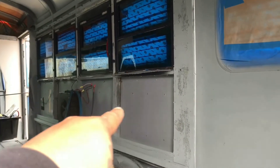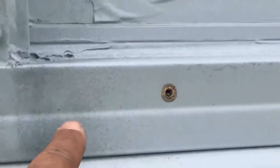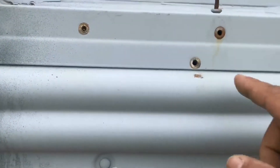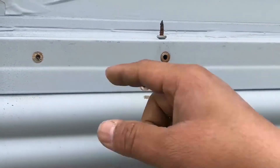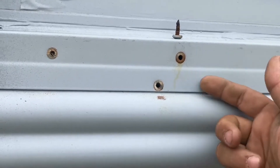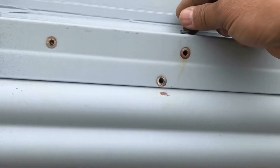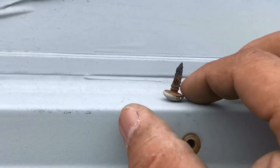Before I move forward with my water leak test — I am taking in water with my rub rails where the screws are, and up here underneath the window with these screws. Normally when you remove that aluminum wall, that section actually folds underneath the window, flaps on the outside, and is held in by screws. During my walkthrough I noticed the screws on the back side were in pretty bad shape, and it allowed water to run inside. You can see the watermark — it's actually penetrating the screw and getting behind it. Look at the shape of this screw, that's pretty bad guys.